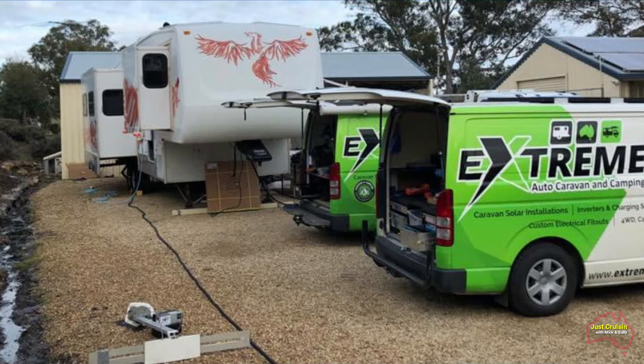Well, that was probably a month from that period and I still hadn't heard anything, so I started to ring around some mobile technicians myself. One that I spoke with was Matt from Extreme Auto Caravan and Camping. Matt was very switched on with all this - he does it every day. He told me straight away that the electronic management system in the batteries themselves needed a perfect situation for the management system to work as claimed. If it goes outside those parameters, it's just not going to charge the batteries - and that's exactly what happened with us.